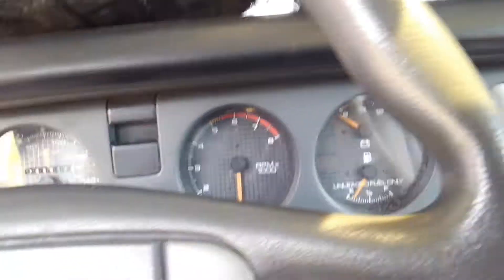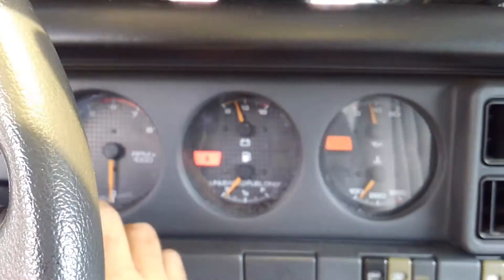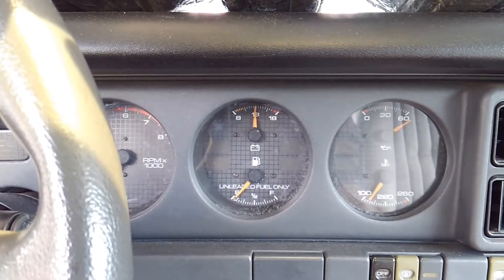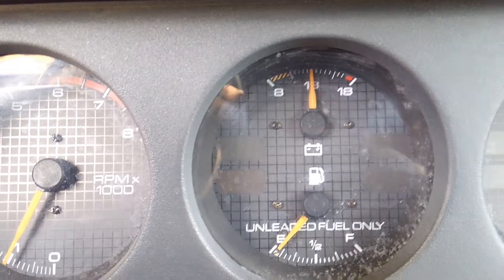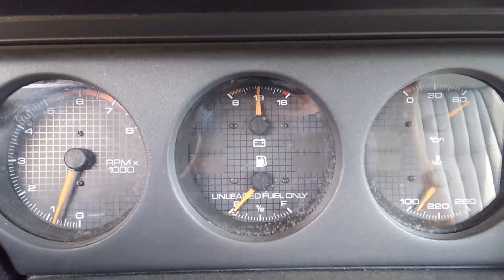What I'm going to do now is fire it up and see how our voltage variations are looking. If you remember, this thing was all over the place as far as voltage. Let's get the radio turned off. Right at initial startup, we're looking pretty good — we've got a rock-solid, dead-buried-in-the-middle 13 volts, which is exactly what I want. Now I'll start adding some load to the system. I'll put the hazards on — hazards flashing, and I've got no drop in voltage. That's good.